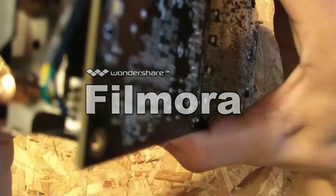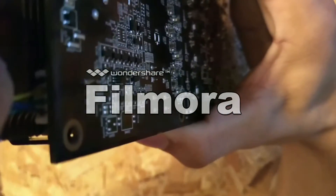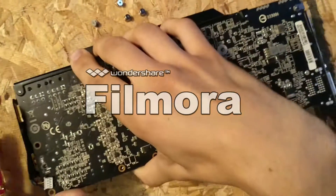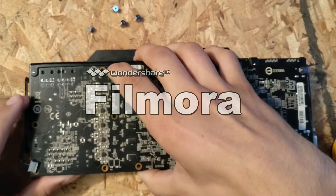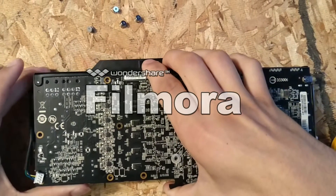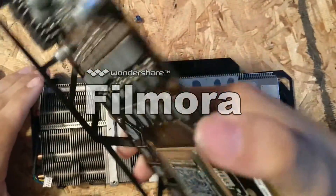You need to unplug your fan cable or it'll get caught when you take it off. It's not too complicated, but just unplug it and then it should pop out fairly easily. If you're having any issues, please double-check your card and see if there are more screws you did not undo. It should come off with minimal effort.